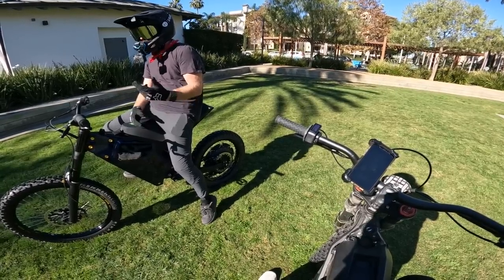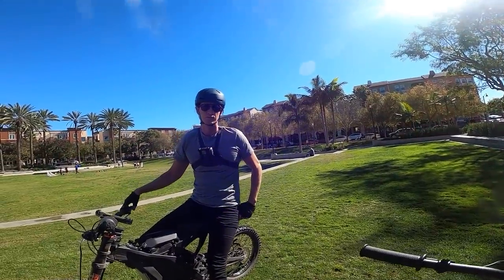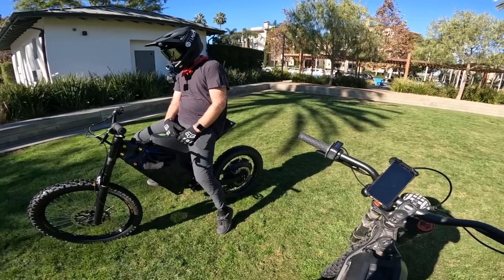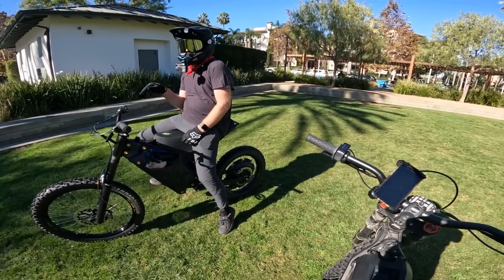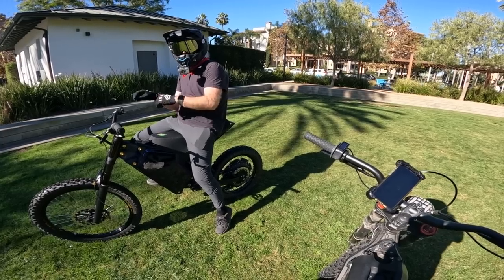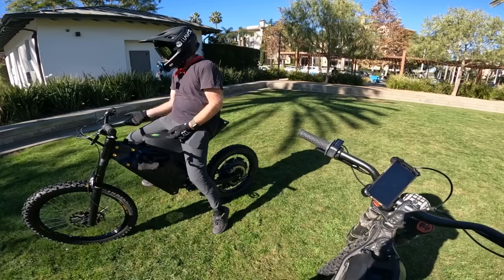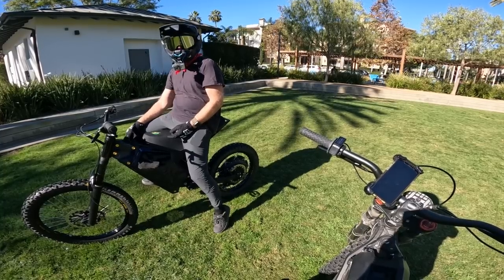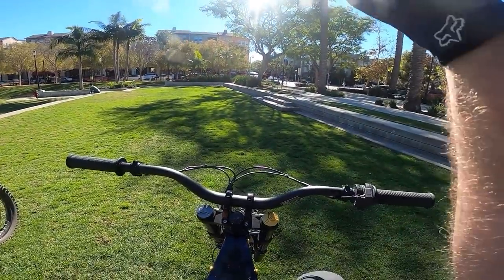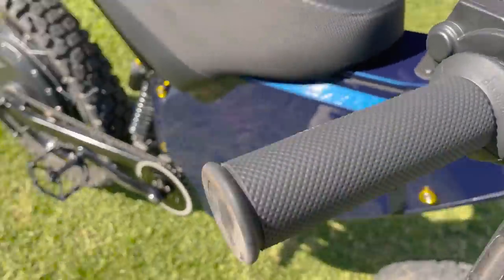There's give and take. That suspension is very strong, but it's less controllable in terms of settings to dial it in. This is a happy medium between that and the Fox, where I get lost in the settings. There are so many high and low speed rebound settings, and I can't really tell because the weight of these bikes is so much different than a mountain bike. That's why I like very simple compression and rebound settings. That makes sense. And then Thompson stem, 3-inch ProTaper bars, Magura MT7 Pros, MT5E lever blades.